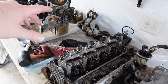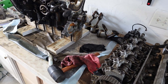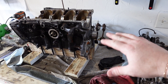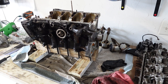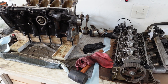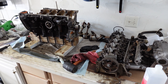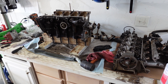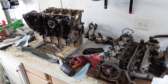I have a Z6 head that we're probably going to get surface checked, then change valve guides and go with something like a Street Savage cam from Speed Factory in the future. The main thing I want to do is get this bored and honed and built even if it's on a stock head for now — I can always add the cam later. It's going to be my project car; the EK will be my daily so if the EF is down with the head off for a month it's not a big deal. No power steering or AC on this car. I'm probably going to sell the interior off the EF — it's in flawless condition — and do aluminum doors with just sound deadening mat to keep it as light as possible for some nice pulls.